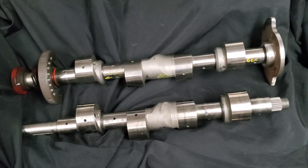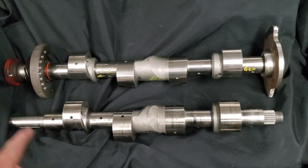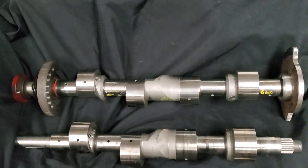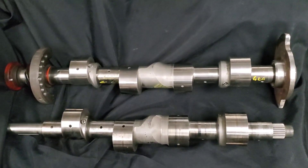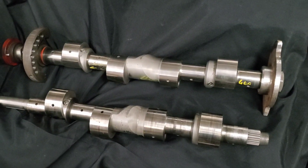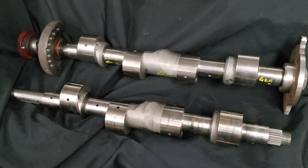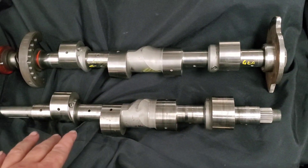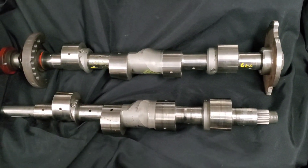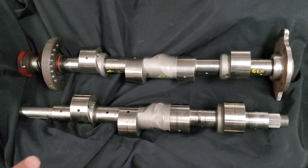I think a lot of people don't even realize that although the eccentric shafts are completely custom, depending on whether it's a 12A based or 13B based shaft, the majority of your four rotor components are based off of OEM components. So if you're building a 12A based four rotor, you need your custom eccentric shaft, you need your bearing carrier plates, and the majority of your other parts are going to be 12A components.